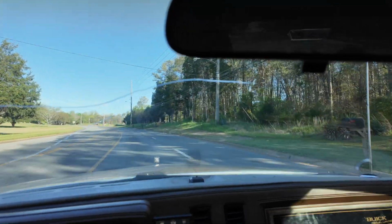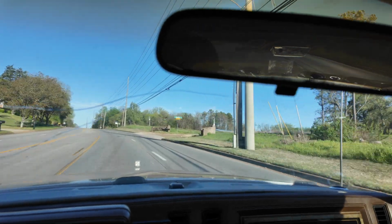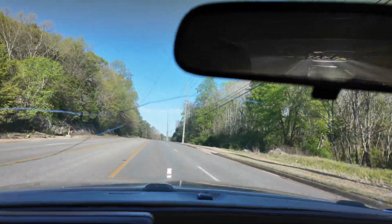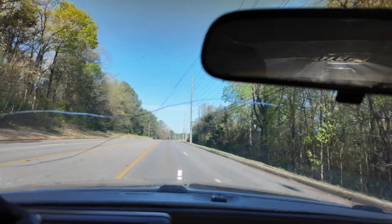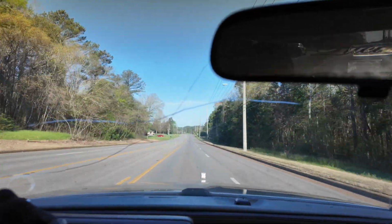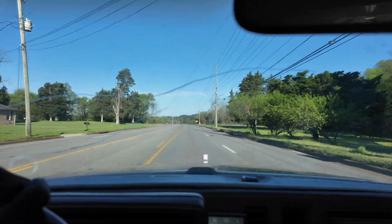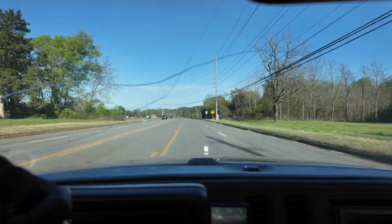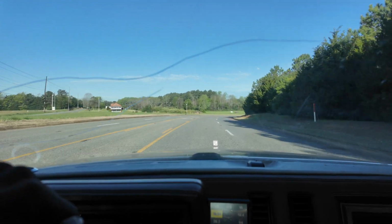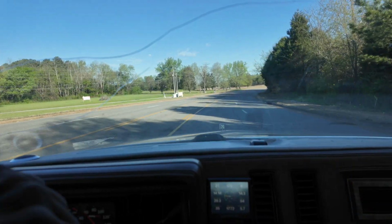She runs pretty good, guys. We gotta do some stuff to the suspension. I already got my Moser 12 bolt for the G-body, my housing and axles. I got my brakes. I'm going with the F-body rear and the S10 fronts. I just gotta get the pads and the rotors. I already got the backing plates and the spindles for the front. I just gotta get my posi unit and my gears. I'm probably gonna go with like 342 gears or 308s and go with a true track posi.